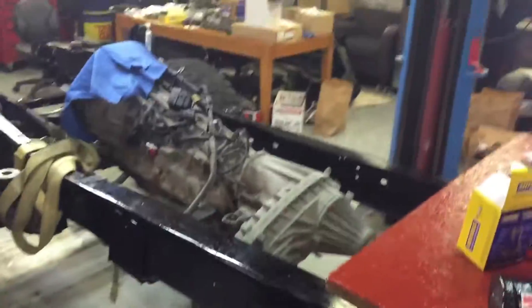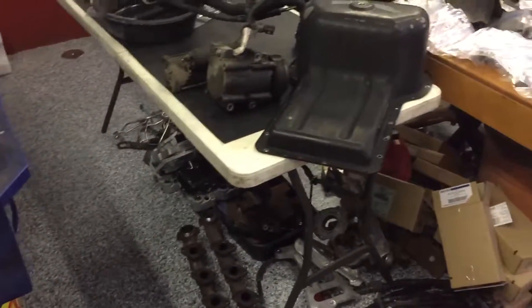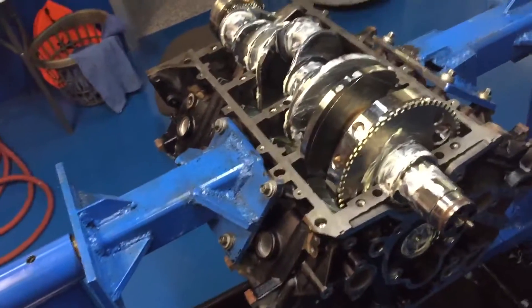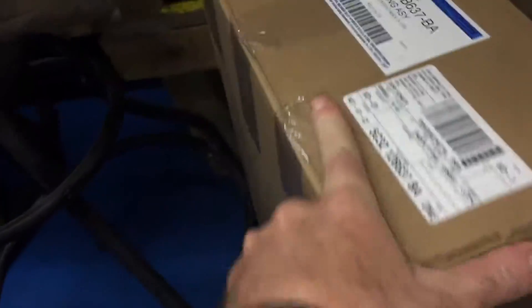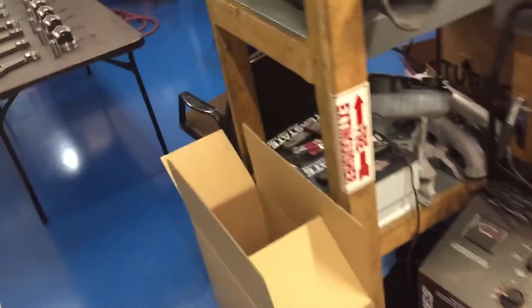He bought. This is a 2003, and he bought an engine that was an '05, '06. I have quite a few parts here that are extra, because we are swapping the entire engine over to an '05 — down to everything. Here's his engine right here. Same block. I test fitted it before we sent the block off to make sure it was good, and it's only got 5 thousandths in play on the crankshaft. Didn't hurt anything. Just swapped the crank out. He got a new front cover — they used to be really hard to get, but '05 front cover, call it an oil pump kit. All new shiny. This is worth more than a front cover — '05 engine harness. Going to swap it over. It's got the '05 FICM harness.